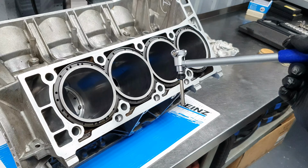So that's why, when you have a high mileage engine with this kind of cylinder wall, you cannot touch it. You cannot do anything there, obviously. Leave it as is. Continue driving it as is until the time comes that it's misfiring, consuming oil, or whatever. Now, to change the timing chain, yeah, makes sense. To change connecting rod bearings and main bearings, yeah, maybe, probably, for some people, I don't know. Or to fix the cylinder heads, lap the valves, change the valve seals. The valve guides are not suffering in these engines; they very rarely have a problem, alright.